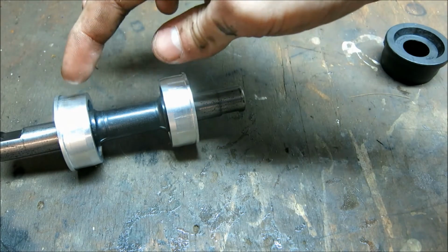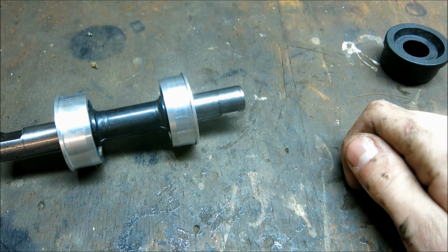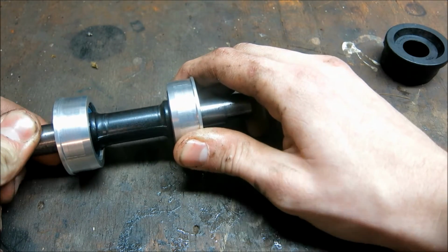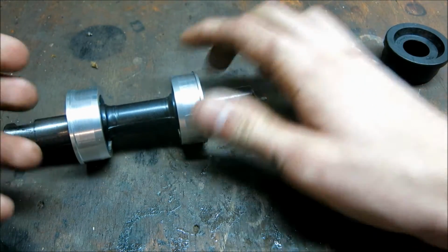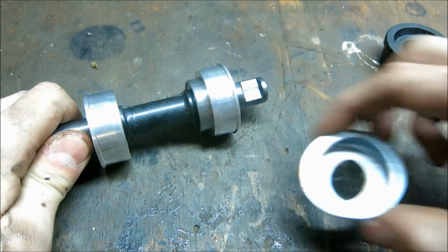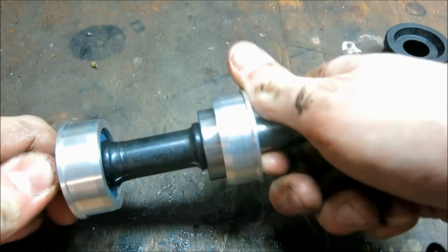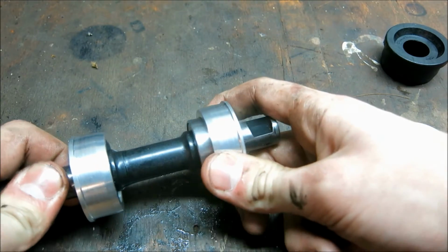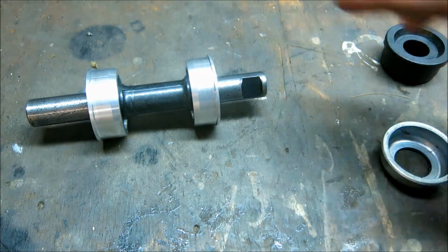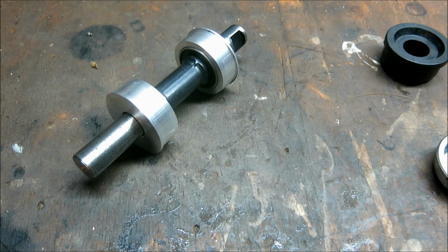First of all, because you can't machine this exactly to fit the bottom of the bike, and second, so that you have a little bit of adjustment in width for play, and so that the bearings in here don't get wedged together. These are just straight bearings, and originally they were angular bearings, so they would get adjusted through side force. And these are not so tolerant about side force. So to take out the side force, this one is a slide fit on here. So this basically just gets punched into there, and with properly hardened raceways, I could imagine that this works quite well.